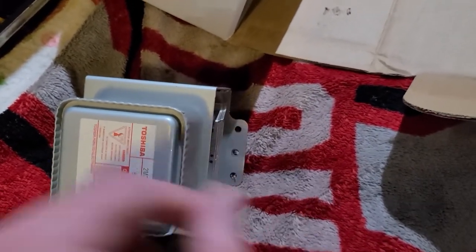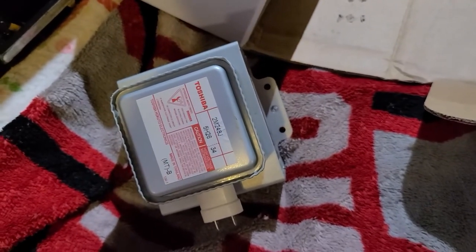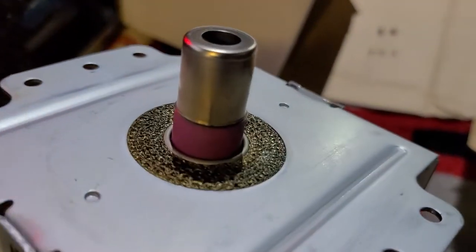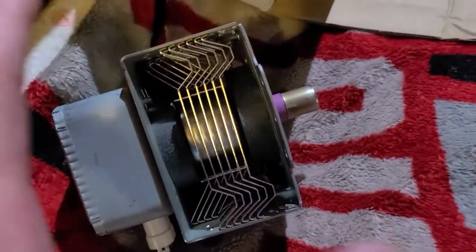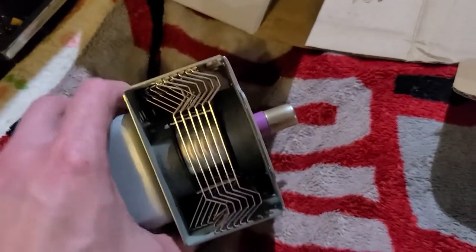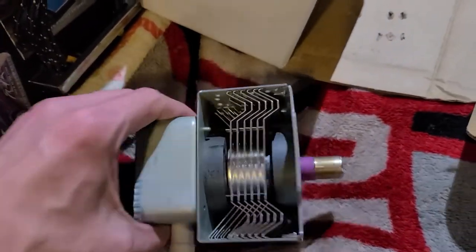Most of the time you'll have one screw — there'll be three screws in these and then they'll have a little top plate with a thermistor switch on top, but they're easy to replace. That was the biggest issue why it wouldn't heat — the magnetron. That's what a magnetron looks like if anybody hasn't seen one up close — there's some heat sink fins and two magnets. The magnetron is technically a microwave gun and the microwaves are dispersed throughout the microwave oven in order to cook your food.